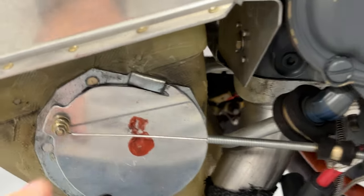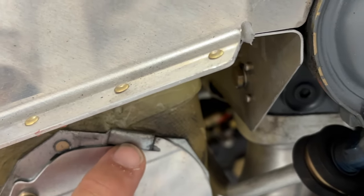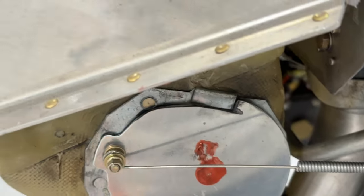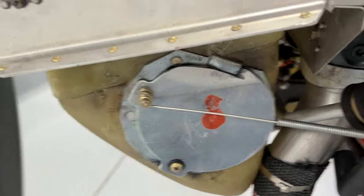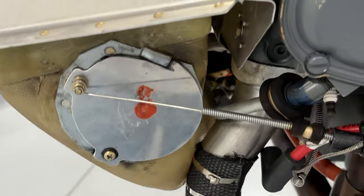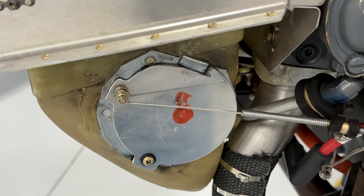Sometimes you've got to pay attention and go reset them manually — they're not meant to be reset in flight. What I would tell you is pay attention: this is a little galvanized piece of metal, and if it sits there and gets bent more than once or twice, this little flange area here breaks off, and that's what you saw on the one I just showed you earlier. I'd encourage all of you to check those. You'll see this same setup on the horizontal inductions — the ones that have the FAB airbox on the bottom — it actually uses the same kind of alternate air adapter.